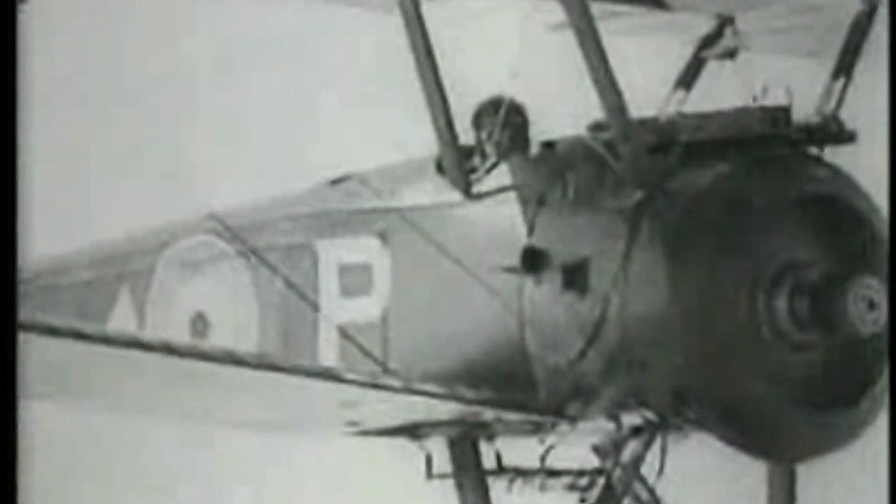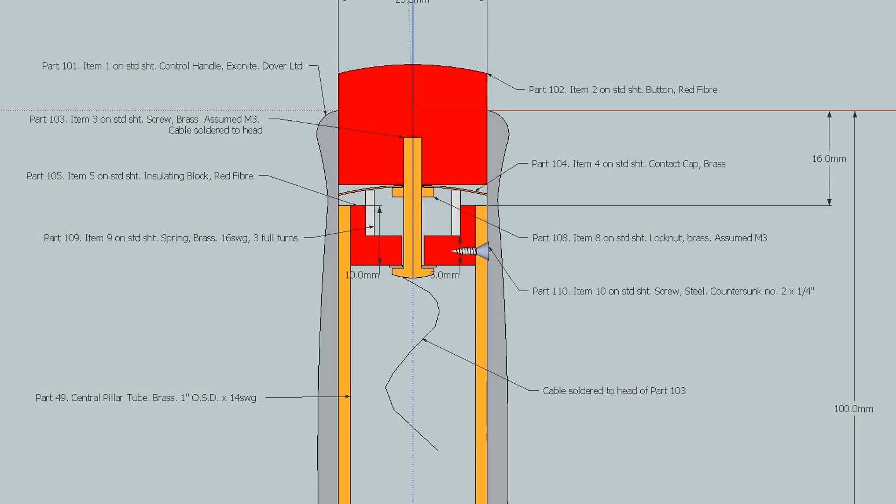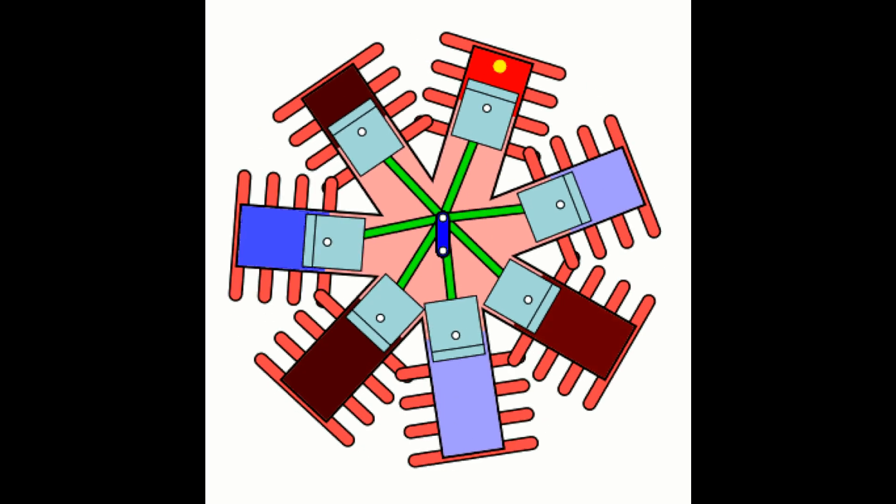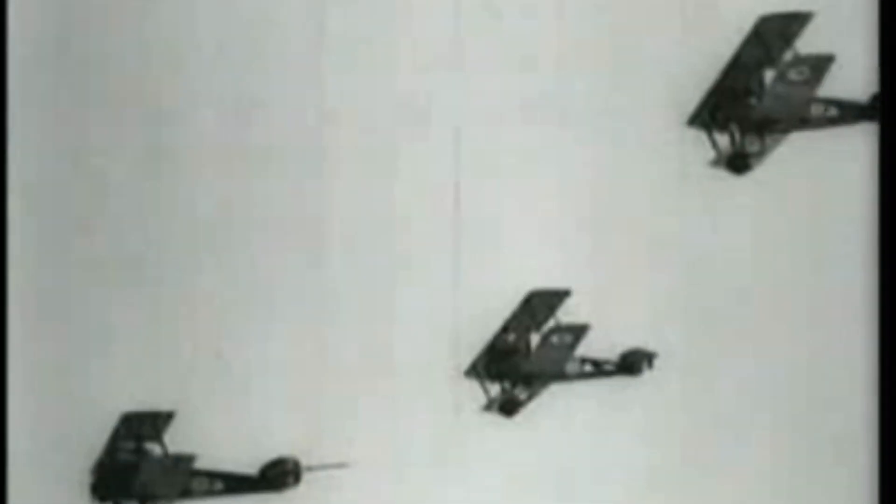But there were disadvantages too. Spinning this big hunk of metal leads to a gyroscopic effect that makes the aircraft hard to handle as soon as you want to turn, which of course is what you want to do in combat. Also, with many rotaries the throttle system was tricky to control, and some essentially had only two power settings: full blast and off. In order to reduce power for taxiing or landing, something called a blip switch was used to cut the spark to the cylinders and thus reduce power. Of course the fuel and oil were still flowing, which could cause fires downstream in the exhaust systems and lower cowling. The limited power setting controls meant that fuel consumption was high with rotaries.